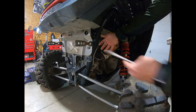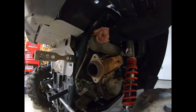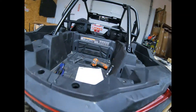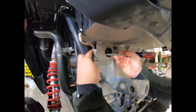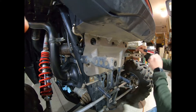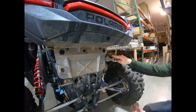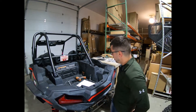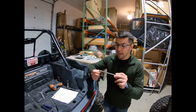Once that's removed, it's easy if you just drop it down a little bit so you can get to your air sensor, which I just have tucked up here out of the way. I'm not sure on the exact size — I just used a Crescent wrench, but be careful you don't round out the sides of the bolt. Next, just remove these rubber mounts — just take a screwdriver and push it from the inside out. After that, remove the mounting hardware on the actual head pipe to the cylinder. There are six of those and they are six millimeter. I suggest getting a long six mil bit to make it a little easier to reach a couple of them.